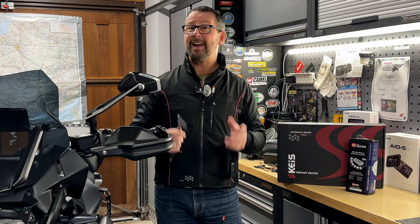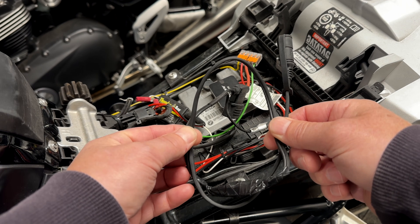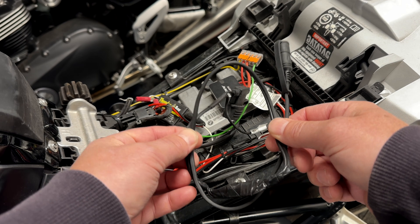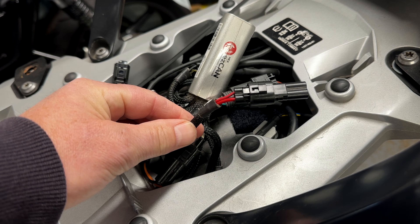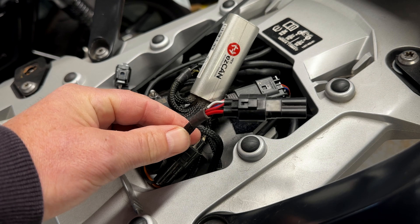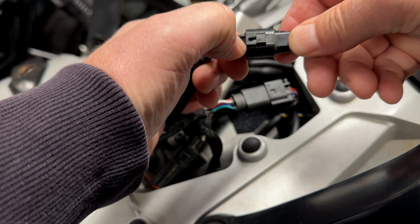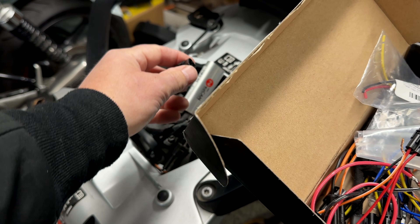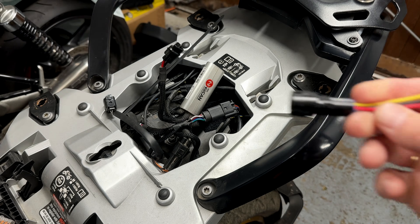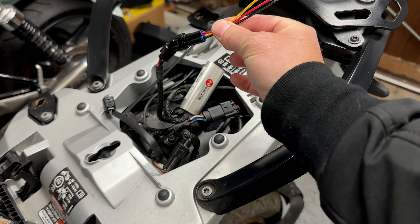So how do I now vary the levels of heat coming into the jacket so it's nice and comfortable for me? Well that's where the Hex Easy Can comes into it. First off, disconnect the cable supplying power to the jacket — in my case it is a Thunderbox Accessory Manager. My Hex Easy Can has got four circuits; three of them are in use so the spare circuit is the red circuit, so I'm just going to remove the dust cap. If you check your box and haven't got any plugs to connect onto here, then what you can do — which is what I'm going to do — is use one of these pigtail connectors from Denali which will fit onto there.